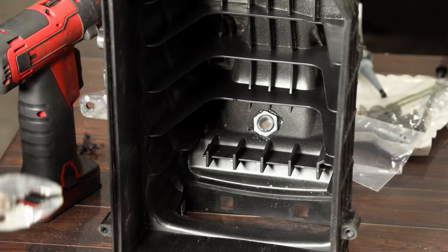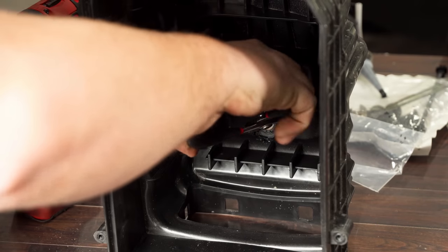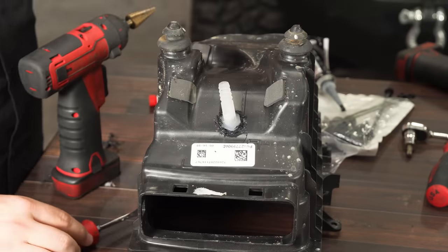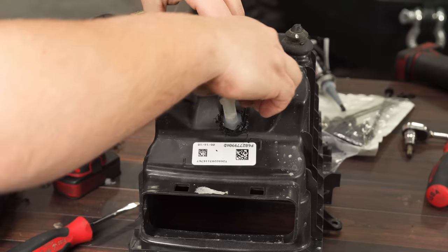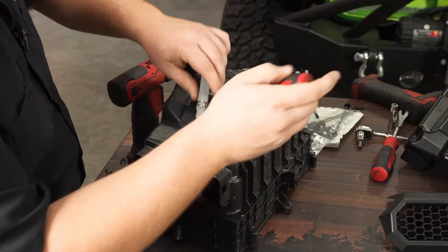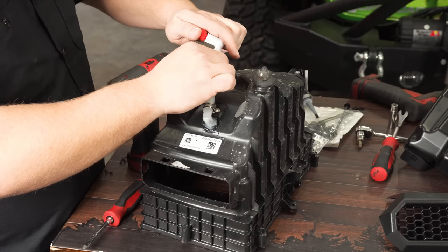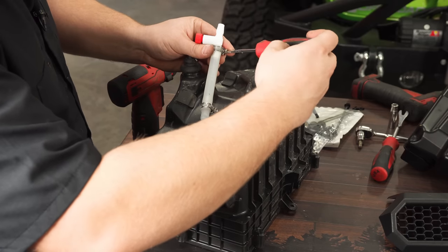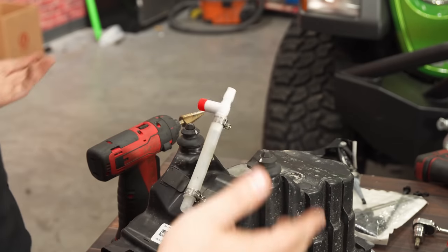After the silicone is on, flip it over. We flipped this over and put a little silicone on there plus the plastic nut. To get this tightened down I'm just going to use a small pair of pliers, as tight as I can get it by hand — it doesn't have to be crazy, that's just what's holding on the drain valve. We've got a small drain tube — push this onto the elbow we just installed making sure it goes all the way over. Get the hose clamp on there and twist it up underneath there, then get that tightened down. After we have that on, next is going to be this T fitting. Slide another hose clamp over it, slide that fitting on — this is what will actually release the water. Get that band clamp tightened up as well. Look down this check valve and make sure it's completely closed up, thread this all the way in, and we're good to go on this air box.